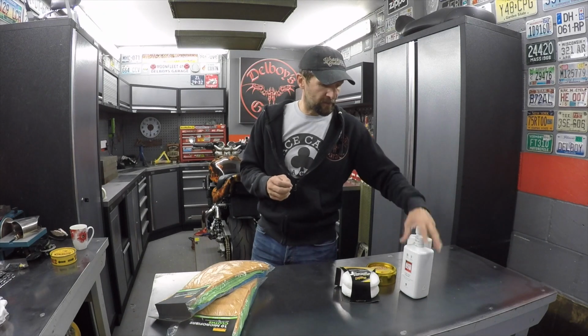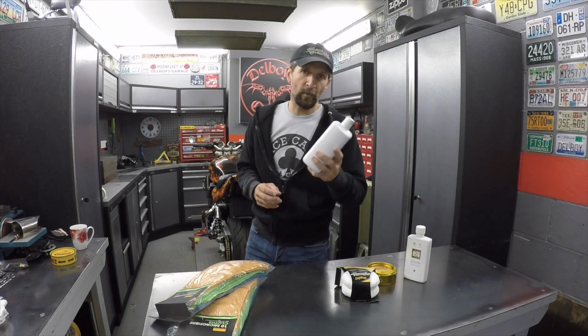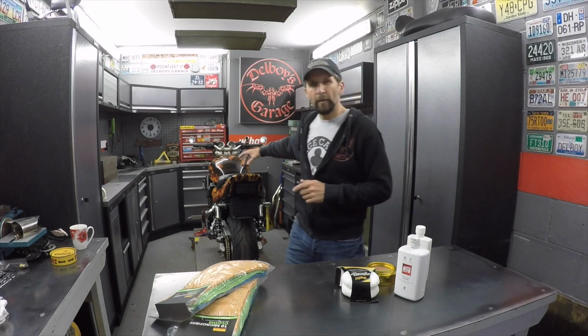So you use a polish. Most polishes have a very, very super fine cutting compound in them. So this is finer than the G10, and this will give me hopefully a slightly better finish. You can't see these scratches, it just takes the form of a bloom over the surface, and I want to remove that. And certain little areas also, I can see that I just need a little bit more work on it by hand. So that's going to be done first.